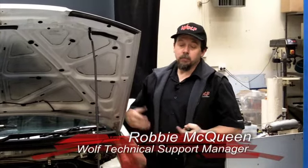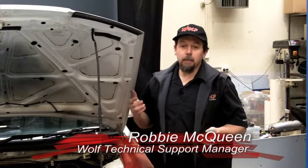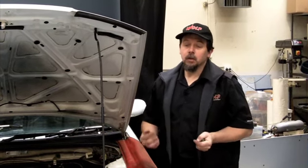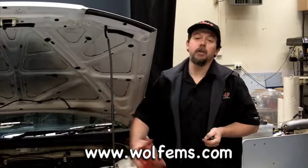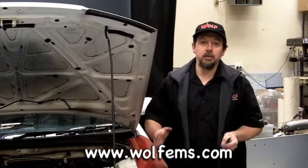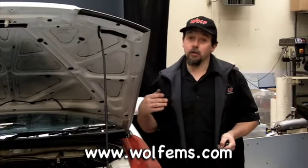When wiring up a car or wiring in an ECU, one of the most important aspects is good wiring. Everyone thinks of wiring as being 12 volt power supply — must have good 12 volt, run really thick battery leads in. But it's not the only consideration; there are two sources to a power supply: you've got a ground and you've got power.